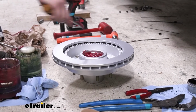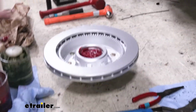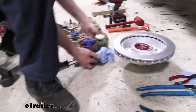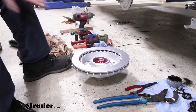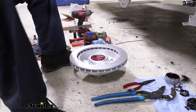And if you were using a style like this one, when you pull it out of there, it's only going to pack the inside. So I usually smear some grease around the outside before I drop it in, if you were using a style like this. We're going to set this aside. We are going to have to pack our outer bearing. It's going to pack the same way, but we don't need to pack it just yet. Let's get our grease seal in so we finish up the back side here, and that'll keep our bearing from falling out of there too.